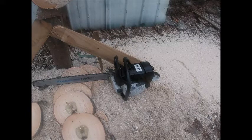Once it fattened up, it was trying to load up, but I was able to tune it out of it. First cut kind of made it look horrible. It just fell on its face and kind of worried me, but as I went to running it and it warmed up, it cleaned up. But as you guys seen, there's room for a lot of improvement on that cylinder, so just take note.